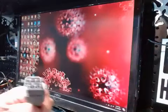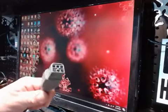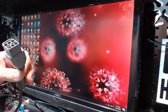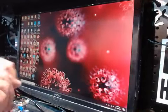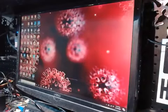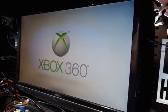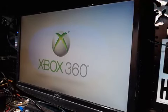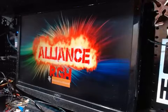Once you've done that, power the console off, put the hard drive back in, then pull the power cord and let it sit for five minutes. Do not apply any power to the Xbox — we're clearing out the DNS and all the network settings from my network. After five minutes, plug it back in, power it on, and with any luck it will boot. You should boot up into FSD Dash and get notifications — green stop means you're linked up.